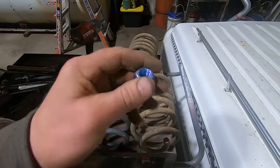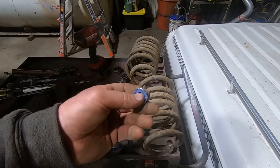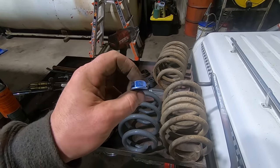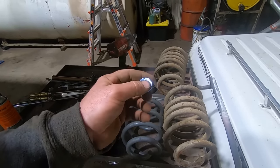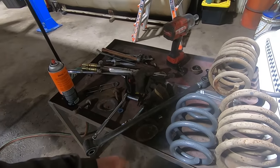but I think they're called a serrated flange nut if you want to look them up. I like these because you can just hit the bolt with the impact, and they just grab into whatever mating component and they don't spin. You don't have to put a wrench. So in a blind location, these work amazing. No, not the Ray Charles location, just areas you can't get at with a wrench. Tech tip of the day.